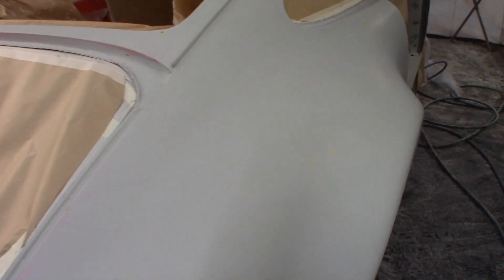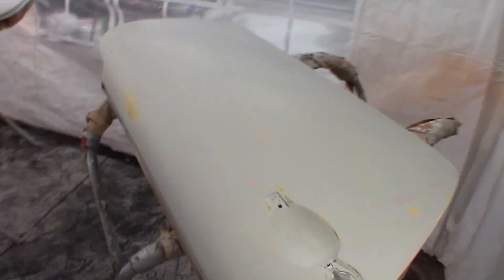So I'm ready to go now for a coat of touch-up primer on some of these areas where I've rubbed through. Here you might be able to see these little pink spots where I've just gone through and put a little bit of putty onto them to tidy them up — a couple of little tiny rub-throughs in places. This door needed a bit; there were a few spots where it rubbed through. This door wasn't too bad — a couple of scratches and spots though.